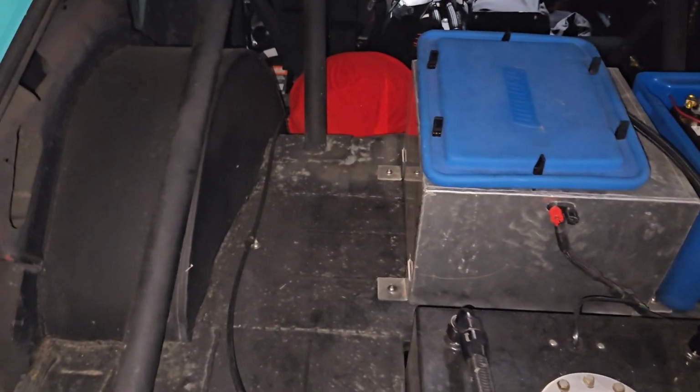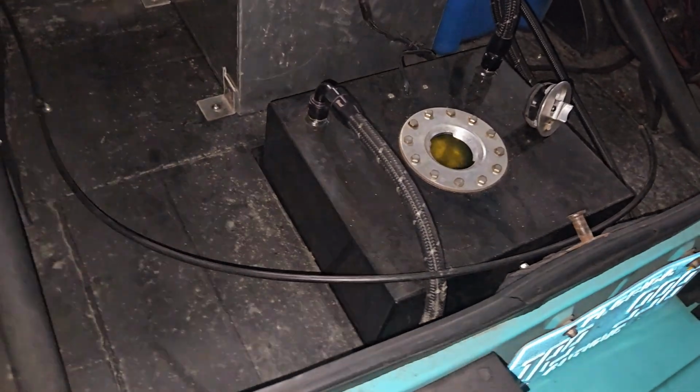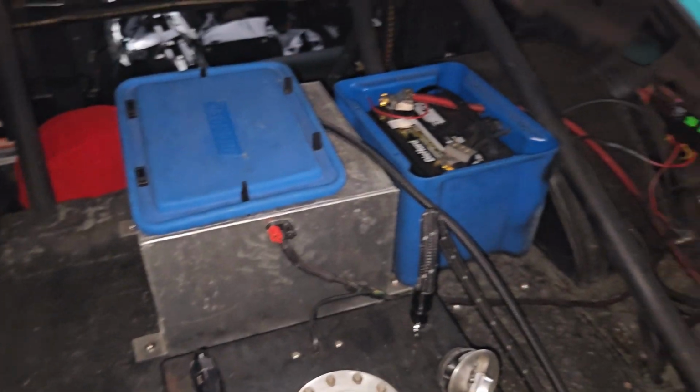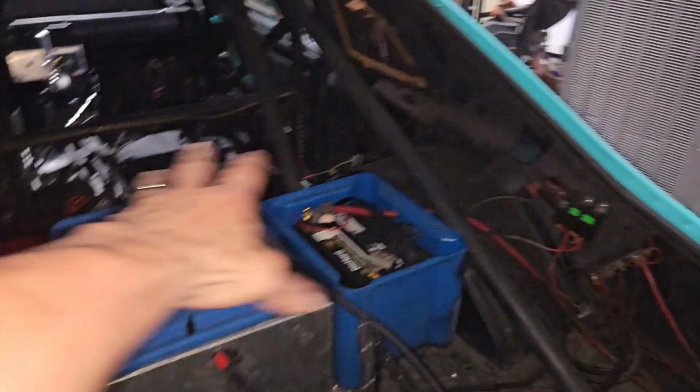After I did the mini tubs, and his car was the one that I did the mini tubs to where they don't drop. You can't really see in there too good, but they don't drop, and they sit up against the frame where you notch these. And I bead rolled them. I sunk the tank down. Lots of work. I did all of these components.